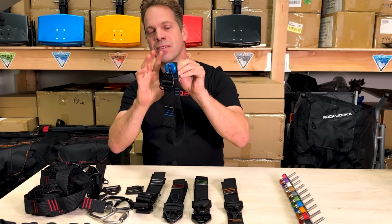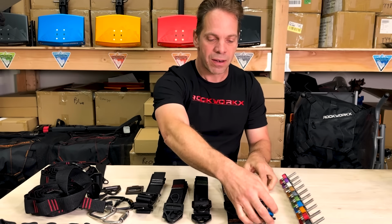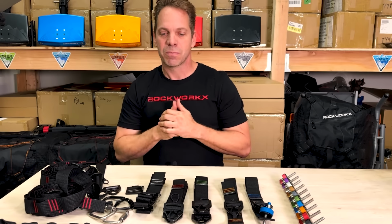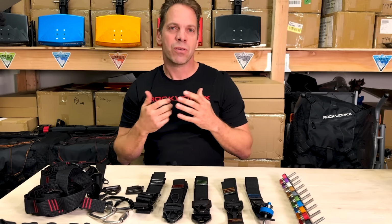We are selling these in kits with the thumb screw for those of you who do have that additional mounting point in your D-pillar. I know most Jeeps do not have those. They might have some openings and things, but they are not threaded. So the only way to do that is then go ahead and put an M8 1.25 rivet nut or something like that in, if you did want to use that.